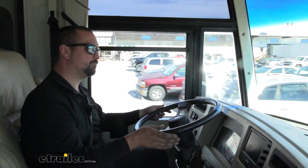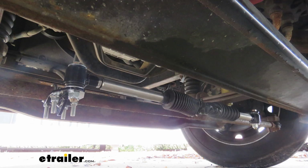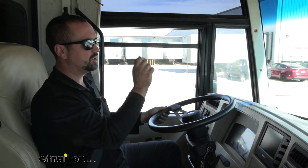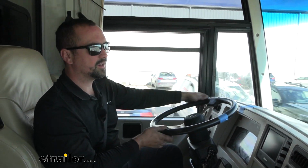properly. Now if it is pulling to the left or right, you're just going to adjust those U-bolts a little bit, loosen those down and move that bracket, and that should align your steering. So just kind of use your reference marks again, and I also recommend using a paint marker underneath to just kind of mark that, and then you can move the bracket. But once we have it dialed in, we're going to see the benefits here.